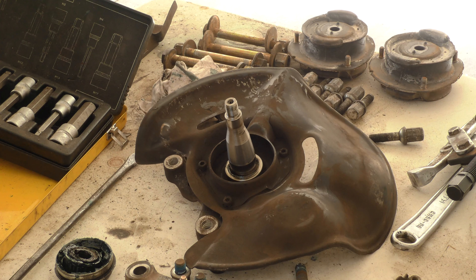Those that disapprove of abusing tools better look away now. I don't recommend this obviously, but these tools aren't exactly the world's most expensive, and I'm yet to damage a ratchet by using it lightly as a hammer to seat these allen headed bits. You really don't want it not seated properly because you'll strip that head, and then you'll have more than a damaged ratchet to worry about when it comes to removing them.